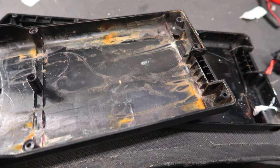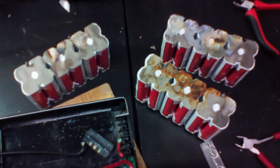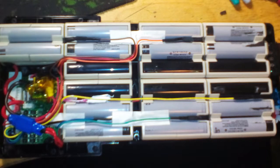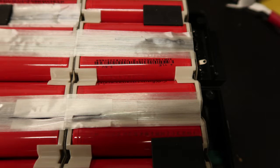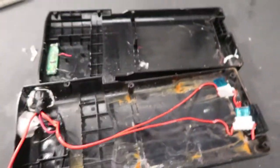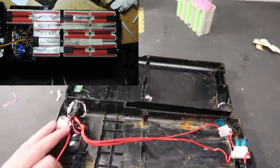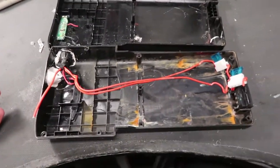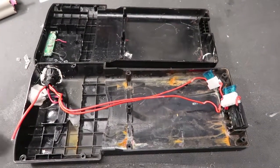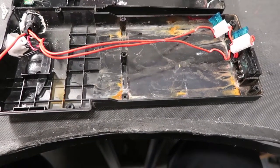However, there is a big problem with water on this battery because it's not possible to use heat shrink and there's absolutely no way to do any form of waterproofing on the inside. The only thing protecting the battery cells and electronics from water is the case itself, and the case is not that good at resisting water. The cells are arranged in 10 different sections, and you can clearly see there's been a lot of water in here, causing rust at the nickel connections. We really don't know exactly where the water is coming in from.